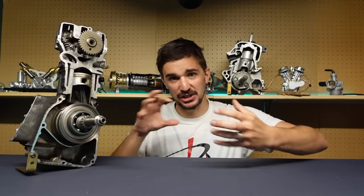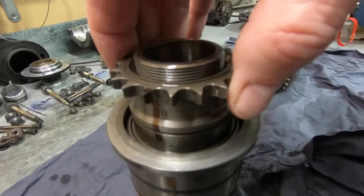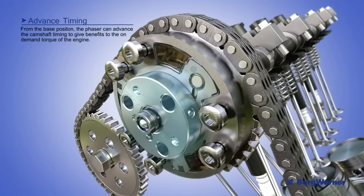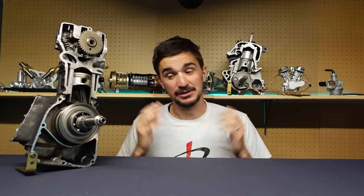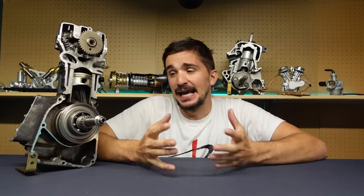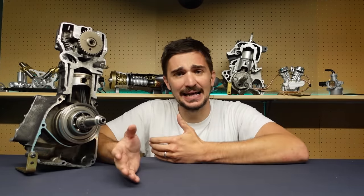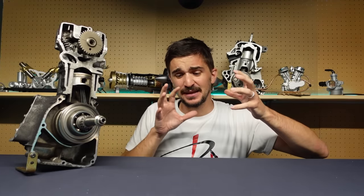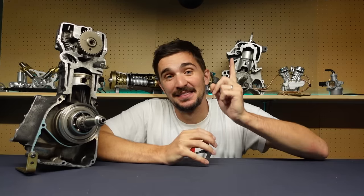There's also a nice benefit when you think about camshafts and rotary valves. The rotary valve barrel rotates just like a camshaft and is driven by a timing belt or timing chain just like a camshaft — which means we can take a variable valve timing gear, attach it to the rotary valve barrel, and get variable valve timing using existing technology very easily. So, definitely a promising technology with its little challenges in terms of sealing, and the timing for it isn't ideal — but regardless of whether it happens in the next decade or two, it is still worth knowing about because it serves as a very nice demonstration of the shortcomings of the ubiquitous poppet valve. Thanks a lot for watching, and I'll be seeing you soon with more fun and useful stuff on the D4A channel.